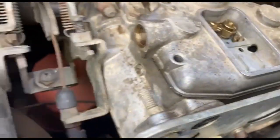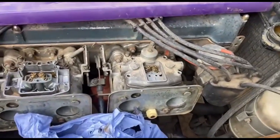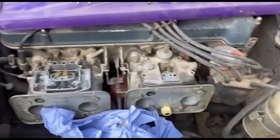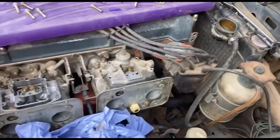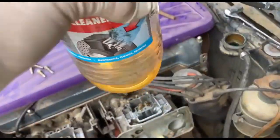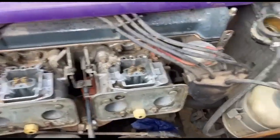Let's say I have got gaskets, but I want to save them for when I take them off and strip them and rebuild them. For now, I just want an object to see if it'll go. So I'm just trying to ease this off with a razor blade or my penknife. Right, I just mopped out that fuel. Obviously, it is a bit darker, so whether it was a bit of residue in there or just, you know, like the treacle left over. So it could be that that one was stuck on the corner. So I'm going to rub the corners of these off, clean that out with a bit of cotton or something, and then I'll just tip some fuel in there and see.